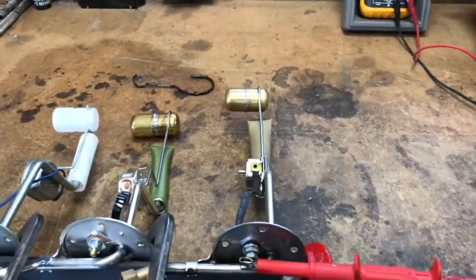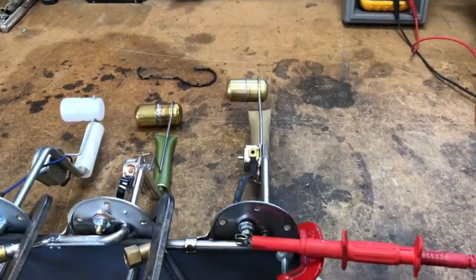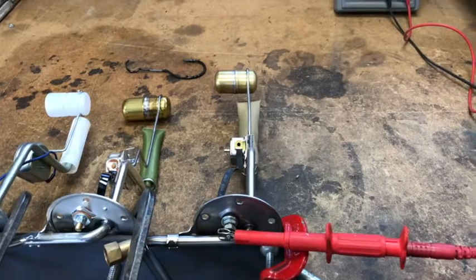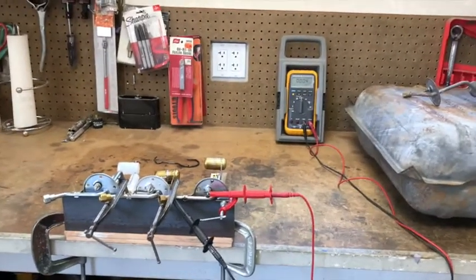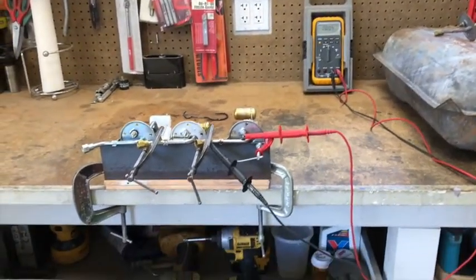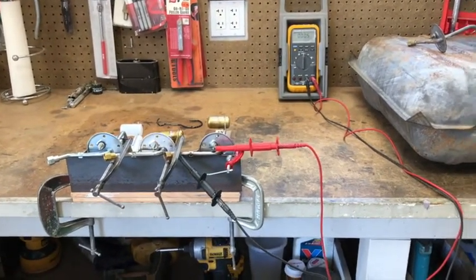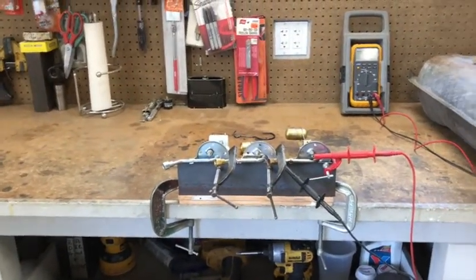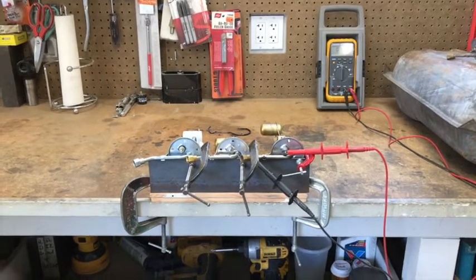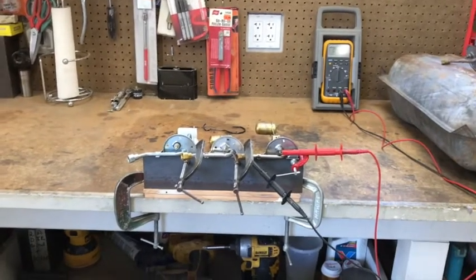I filled up the tank — I put 15 gallons of fuel in the tank with the meter connected to the rheostat and watched the meter climb. That's a 16-gallon tank, at least that's what the specs say. And I had 15 gallons in it and the rheostat was sending 21 ohms — 21 and a half ohms — to the gauge. So it was reading like seven-eighths full, really near full. And obviously at the other end it was reading empty. So I was satisfied with that — it wasn't perfect, but I was satisfied.